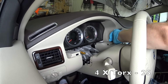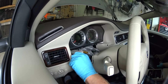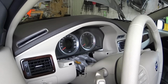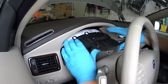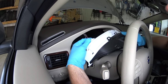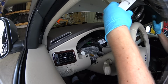And we need access to the blower fan from 2 sides, from the speedometer cluster and the glovebox compartment. And pretty much done. Use the same bone tool, pry out on top, and the speedometer will drop down this way. That's how you're gonna be able to pull it out. Be careful now not to scratch anything. You have to disconnect with your left hand the electrical connector, push on the top, detach, and carefully pry it out. Make sure that the steering wheel is all the way out.